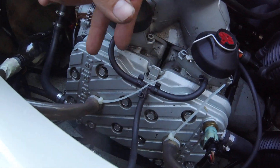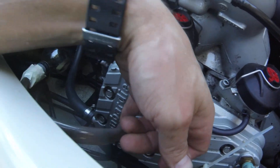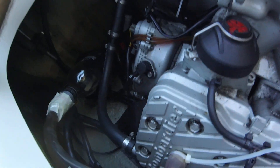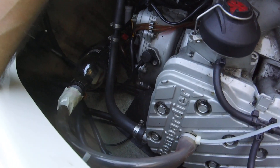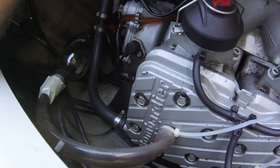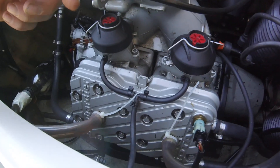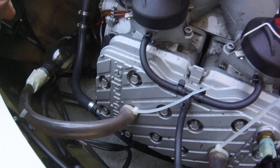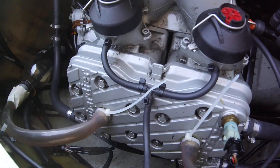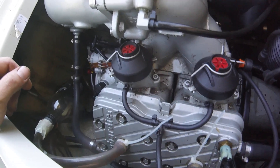After you try and clear that out, put a plug on this side, put your little apparatus on this side, and keep doing it until you are confident you can put both spark plugs back in and the jet ski will turn over. Otherwise it will not turn over and you have to continuously take these off, bring them out, and put the plugs back. It's a pain in the butt. This is my way — once it gets started, you keep it running on the hose for as long as you can until you can get to the lake.